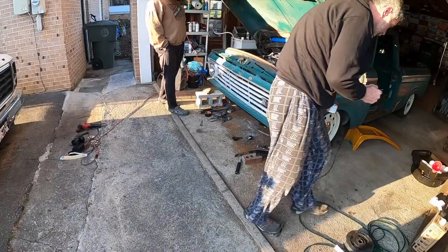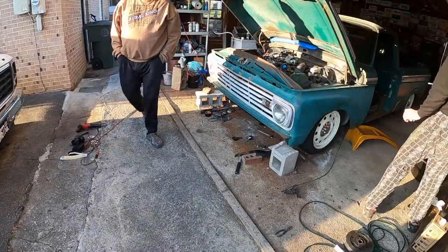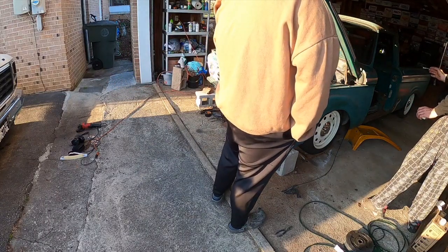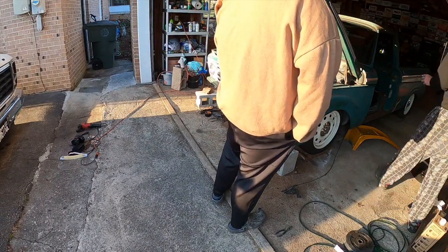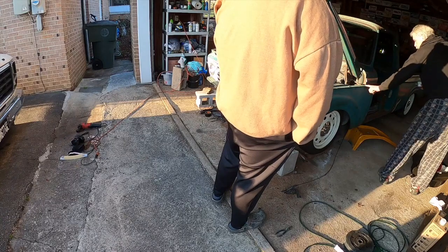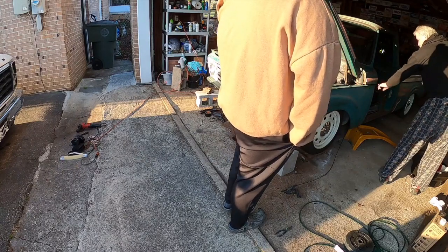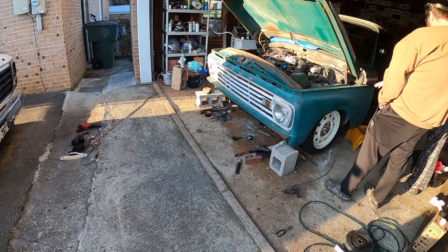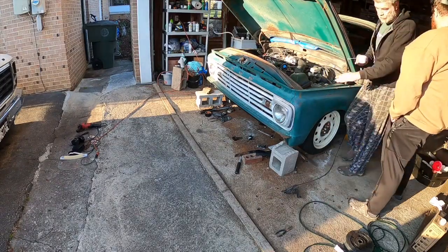Yep. Man, I think we're actually going to be close. The front might need to come up because we're going to have to raise this about a half inch back here. So the front, see, we're going to have this perfectly parallel. This line and this line from the front to the back. We'll have to get up here and really measure with something to make sure we're perfectly parallel. That's how we're going to line up our front to back.